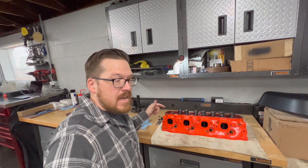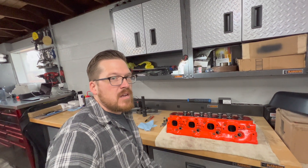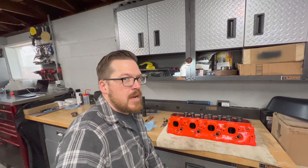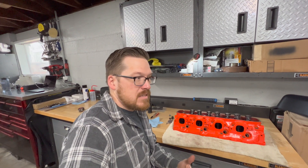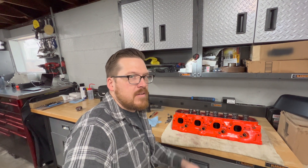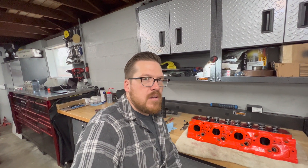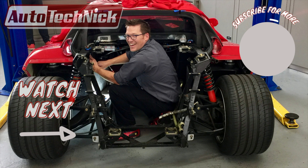Not only does it cut down the valve guide diameter, but also the height. That way you're not limited to stock-size cams. Like I said, most moderate hydraulic flat tappet cams for a big block Chevy almost always stop around 550 thousandths lift — and that's because of the valve guides. It's not really well documented, but with a cutter like this you can cut your guides down and open up a whole new opportunity of cam choices. Thanks for taking the time to watch — please check out my channel for more tech videos and projects.